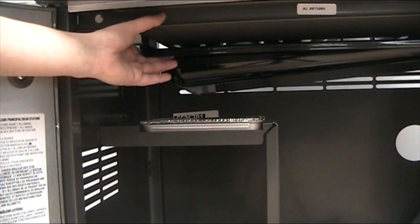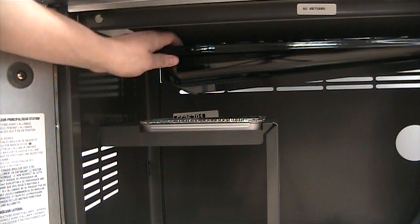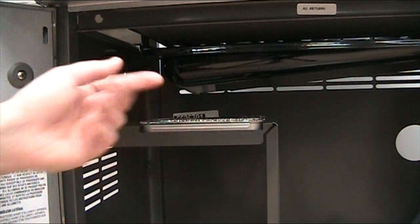Within the bottom cabinet is the drip tray and the drip pan. Because there is no bottom to the aluminum firebox, the grease drips directly into this pullout tray, which then filters down into the drip pan underneath it. It makes for easy cleaning and maintenance.